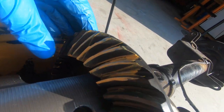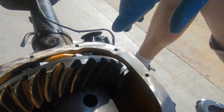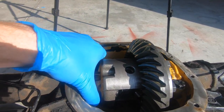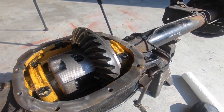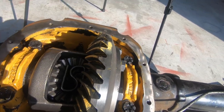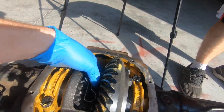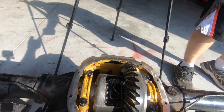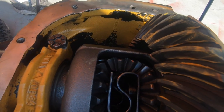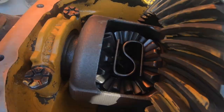On the back side we're definitely getting full contact — you can see it on both sides. Looks like we're in perfect shape; these caps get to stay on. Next we need to get the axles in with the retaining pin and C-clips. The axle slid in — apply downward pressure with your thumb to seat the C-clip, feel it go down, then pull the axle back out so the C-clip seats in the recess of the spider gear. The big pin goes through to keep the axles from backing out.